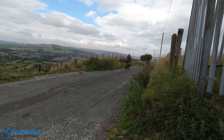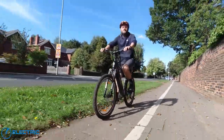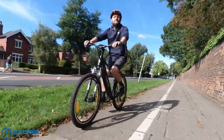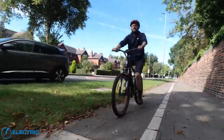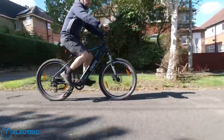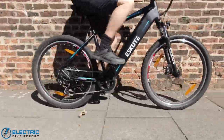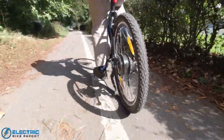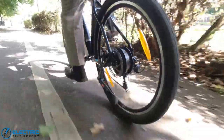The EBR UK test circuit is a 1.25-mile loop with a small hill, four turns, and a couple of narrow sections where slowing is required. A test rider does a lap at each pedal assist level, starting with the motor off. The Natuno's level 1 and 2 weren't a huge improvement over riding with no power at all, as they only assist up to very low speeds. It's the top three power levels where the motor really kicks in and is of most use, giving a marked improvement in lap time. Our only suggested improvement would be to have rider-customisable power profiles, or even the ability to reduce the number of power levels, as the lower levels are quite close and only of limited use.